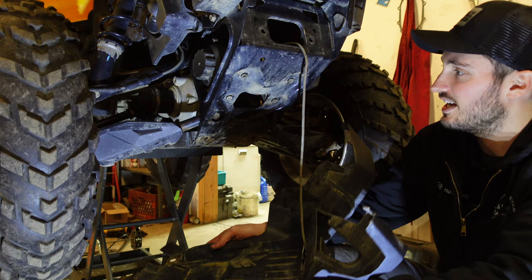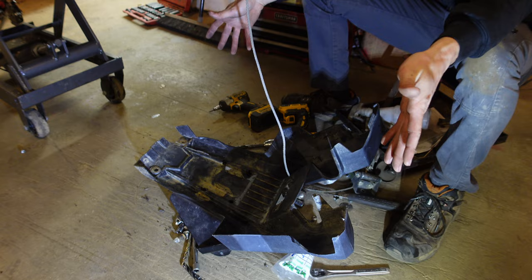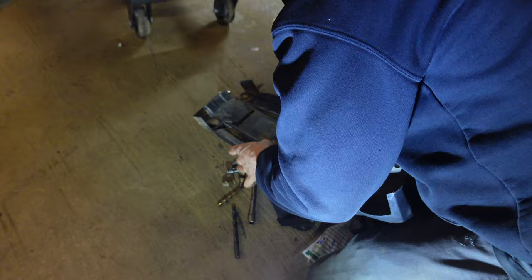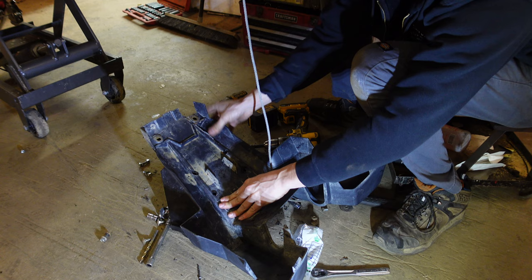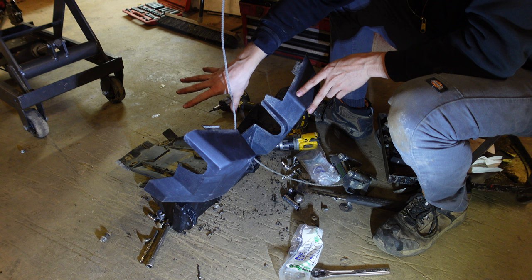These directions were not that great. Sorry Moose, they weren't. Just got back from the hardware store. I got some slightly longer bolts that should be just long enough to catch the threads of our winch but also long enough to get through our plate. Unfortunately my microphone wasn't working so I had to re-record this. What I went ahead and did was set the mount plate on here, used a punch to mark my holes, and then drilled them slowly bigger and bigger until I finished with about a half inch to nine sixteenths drill bit. This thing lines up beautiful — our metal comes through and still makes contact with the winch bracket while retaining a factory look without chopping the plastics up.